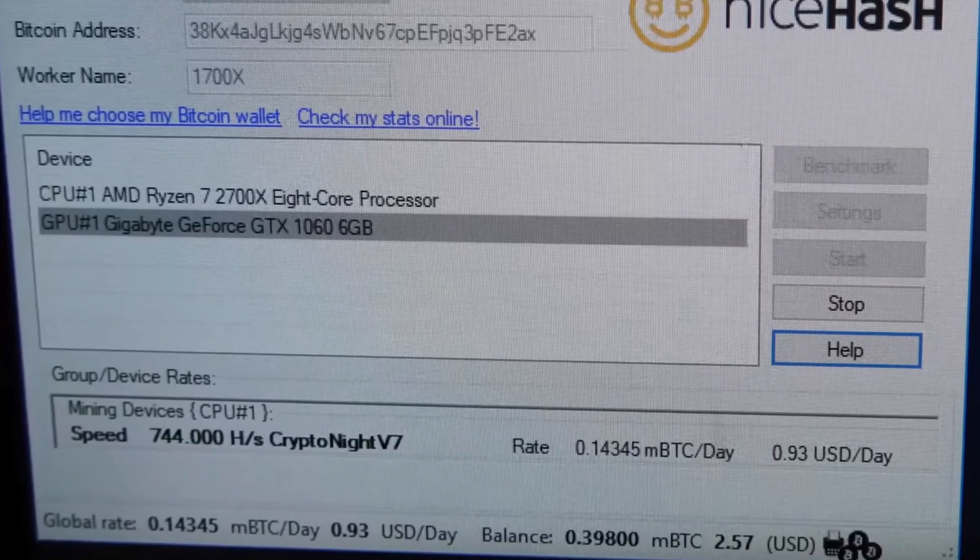Dokio has really low-cost, portable solar solutions — great for RVs or road trips. The 12V DC-to-DC power supply actually worked fine. On a regular 110-volt power supply I managed to get about 740 hashes on CryptoNight, but from this solar setup I'm only getting around 600-650 hashes max regardless of clock speed. It seems like wall power is cleaner than battery power from a solar panel, which affects the CPU. There may be better quality DC-to-DC power supplies available — I've seen some rated up to 250 watts that I might try in the next video.